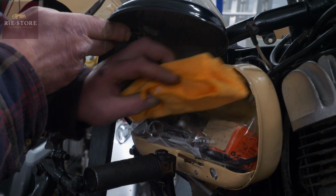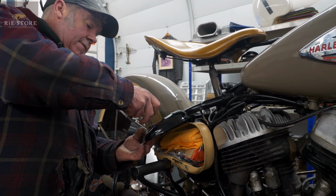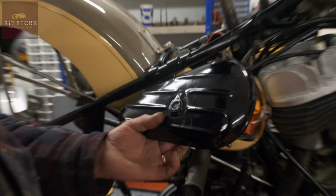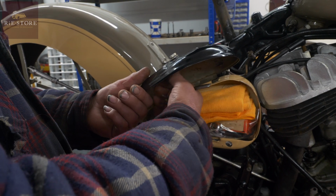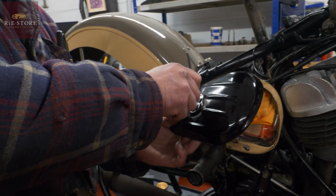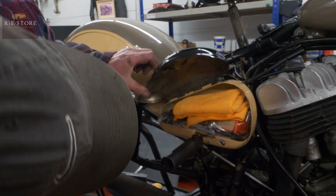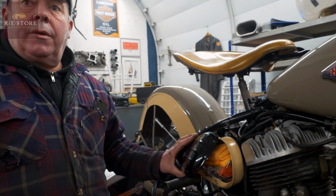Oh my god. So spares and spanners. Yeah, that's what's happened. The ball bearing's gone. I've never changed one of these. So what I should do is, like I say, in that little tube there, there's a spring in there and a ball bearing. So when you put, that's locked. So when you, that should hold there. It can't, it's all free and flapping around. So the spring and ball bearing are gone. And then when you put your flat bladed key in, it pushes the ball bearing up into the hole. So you can turn it. Okay. And then when it comes back round, it should click the ball bearing back into a little recess in there. Like I say, I haven't actually changed one of those. It looks like it's only a screw, so we might be able to just put a spring and ball bearing in it for him. So is it all like one key fits all?